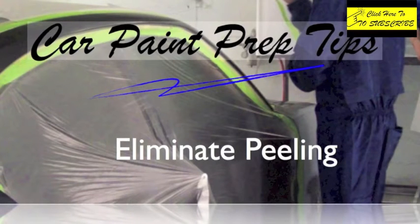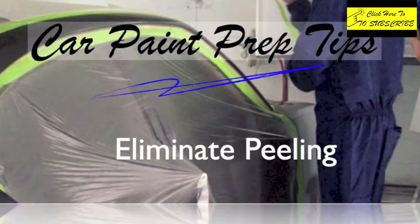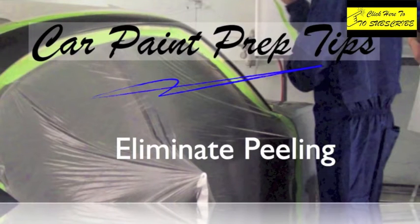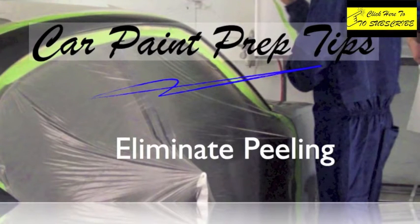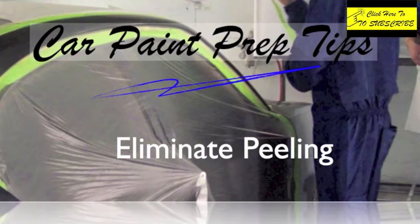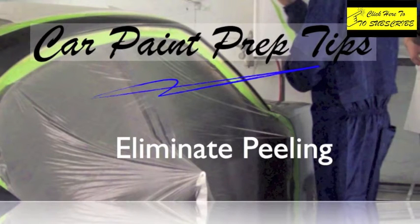And that's something you see a lot of. Improper sanding is not the only reason for peeling. There are some other reasons paint will peel, which we're probably not going to get into in the prepping video. But one of the most common reasons for paint peeling is that it wasn't sanded good in that area. A lot of times, the main areas, the centers of areas, get sanded extremely good, and the edges, the hard to get places, don't get sanded hardly at all. It should be not necessarily the opposite, because you do want the bigger areas sanded good, but you want those edges sanded good as well. So if you want to eliminate peeling, make sure that you sand really good.